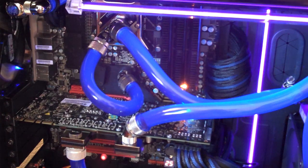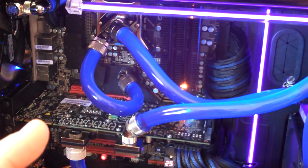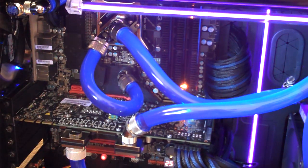Again, I've mentioned this many times, but I swear this is just rejected memory from 2000 megahertz. I'm pretty sure it is. I currently have them running at 1952 megahertz. Run like a champ, like a dream. They're a lot less expensive. There's some upsides to getting the faster memory, just when it comes to overclocking, because you can run them at their normal speeds rather than overclocking the memory to get there, but I love overclocking, so I don't think you actually have to do that.